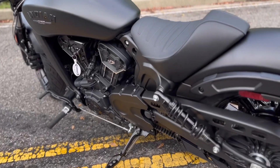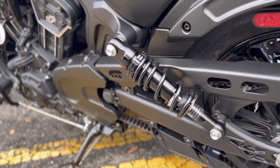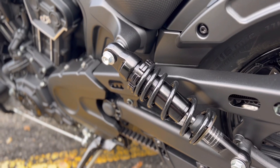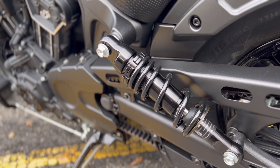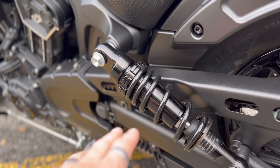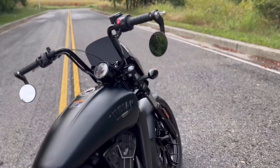Something else that's really neat — you can do this on the entire Scout lineup — you have adjustable shocks. This is just setting the preload. You'll see these rungs right here; if you have a spanner wrench in your garage at home, fit it right there on those rungs and you can tighten or soften the preload. That has nothing to do with the internals of the shock at all — this is literally just preloading the spring tension.